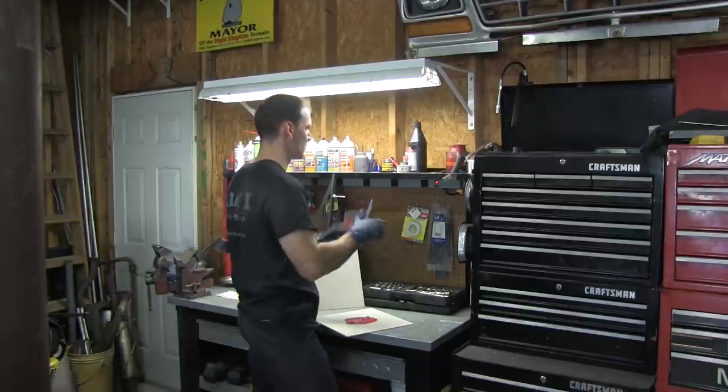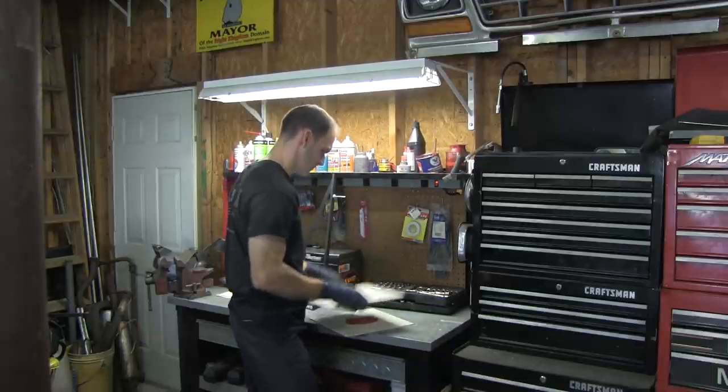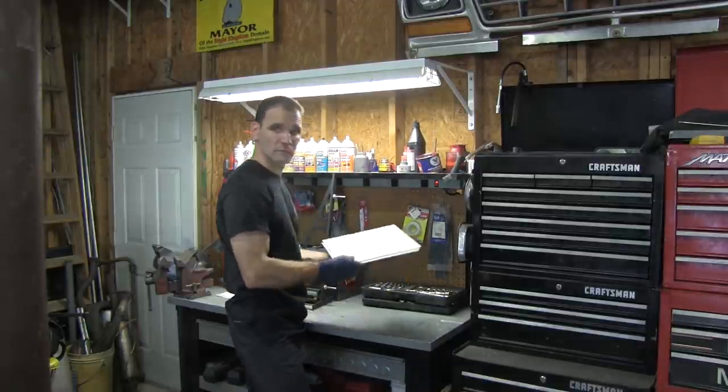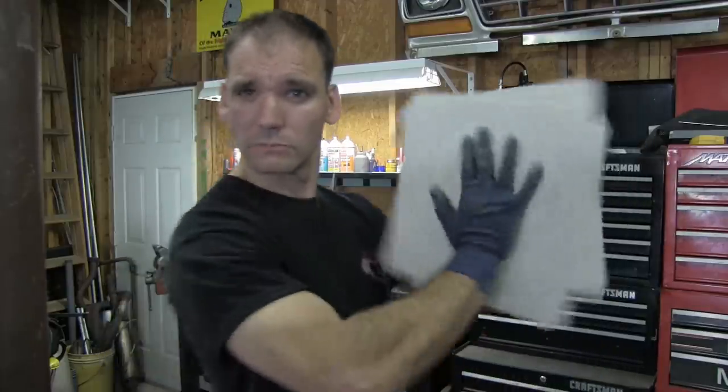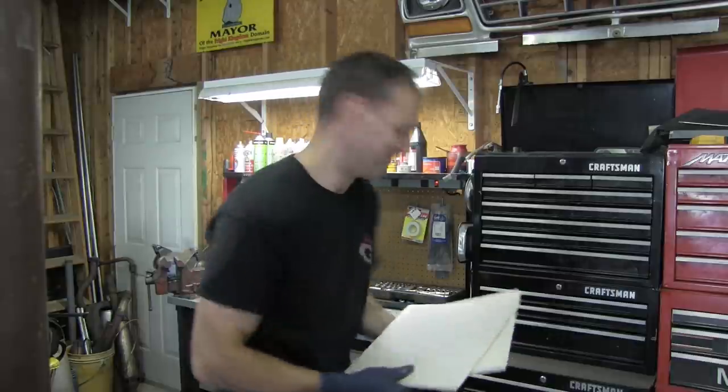All right, once you get the vehicle level, you're gonna wanna lube those spin plates. We're just using two linoleum tiles on top of each other. I found that the best stuff for it is that high temp, high pressure axle grease. That's it, it works awesome. You want the tile that's under the tire to move with the tire. That's gonna be important when we take our measurements for the caster adjustment. Now remember, we're not on an alignment rack. We're up on wooden stands and linoleum tiles. Be careful. I don't want a car coming down on any of you guys.